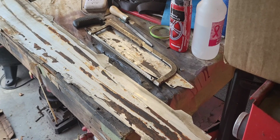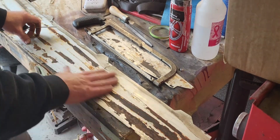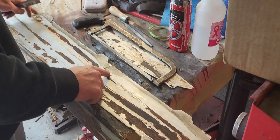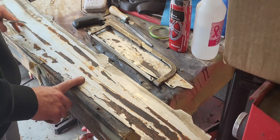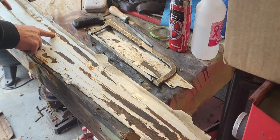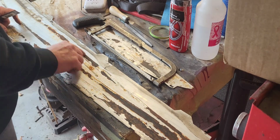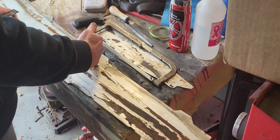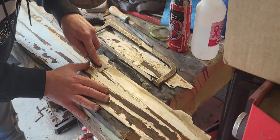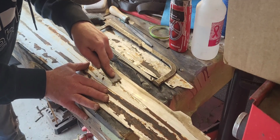I'm gonna go ahead and get this glue off the back of this thing because in my mind, this glue, the way they put it, is what causes these quarter panels to rot out. Had they put the glue this way, it would have allowed the water to come in, go through back behind it, and drain on out the bottom. But being long way, that water just sets on top of that glue and just sets there. So when we glue ours on, we're going to do it a little bit different, but that's down the road.